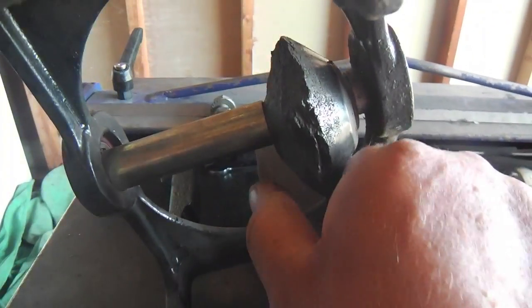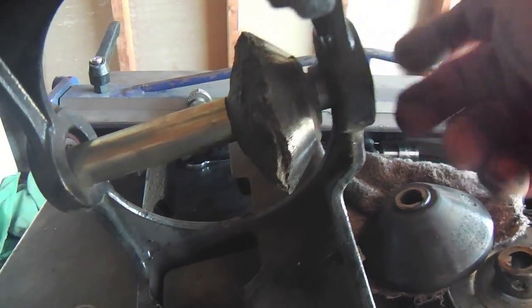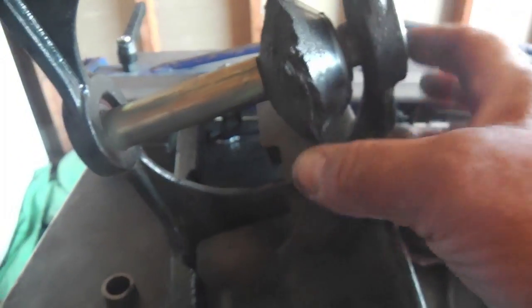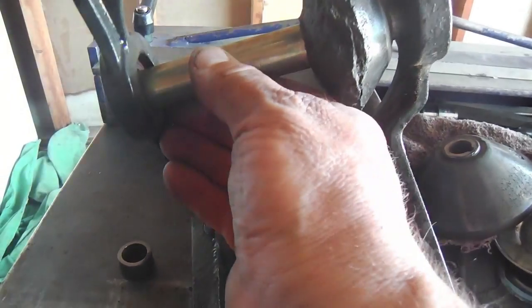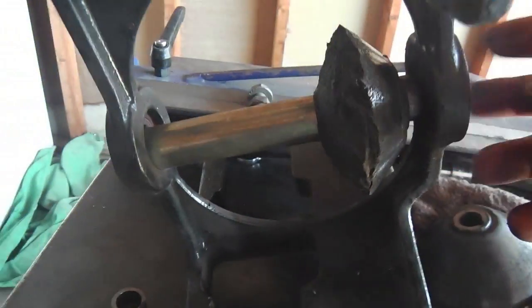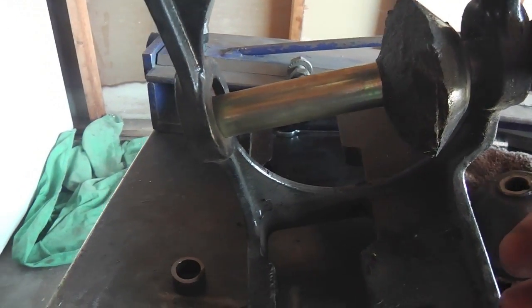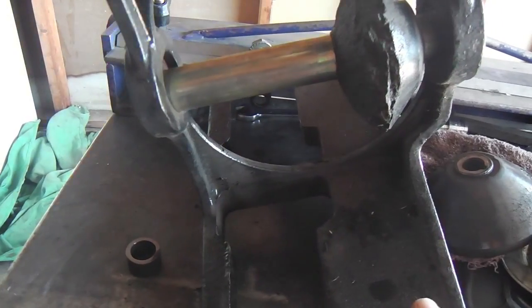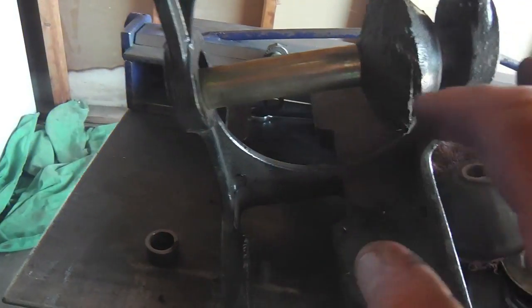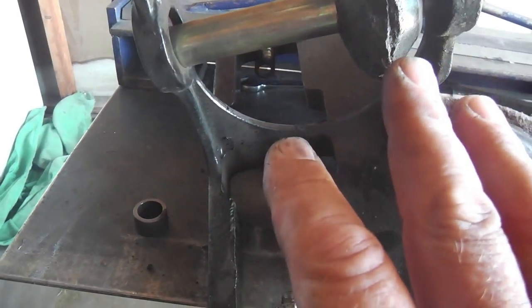And I believe I came pretty close, and the bearing wasn't impinged upon when I tightened it down. So, this is what you'll want. You'll want a tight fit in here, even without any tension on the nuts of the shaft. So just keep that in mind. If you've got your bearings already pressed in, and then you shoehorn these items in, you've probably done something wrong.